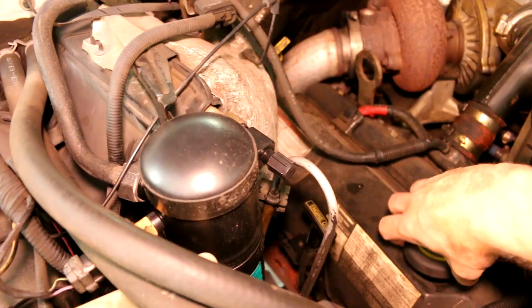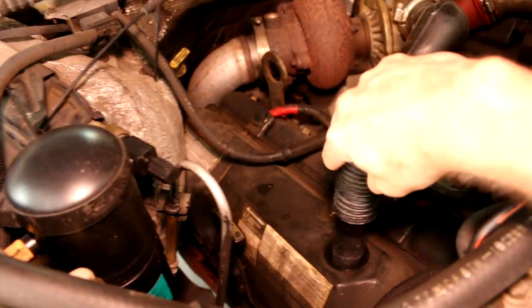We heard Car Talk on National Public Radio — the two brothers from up north somewhere. I can't remember the details of their show or themselves, but they had someone call in one time who had just changed their oil and forgot to change the washer on the oil drain plug and there was a drip. They said, how do I change this gasket or this washer without dumping all the oil out? One of the conclusions they came up with was put a shop vac on the oil filler tube, and then you can take out the plug and the air will just rush in and not a drop will be lost of your new oil.